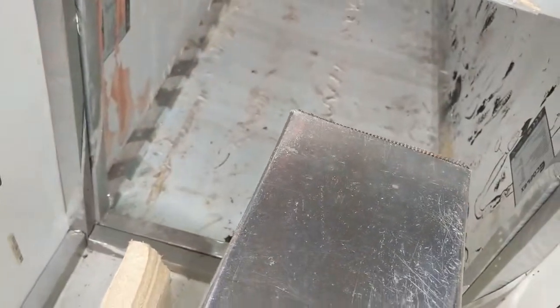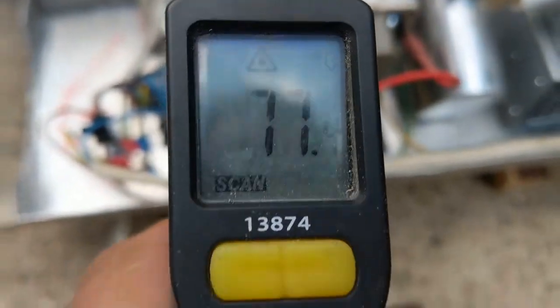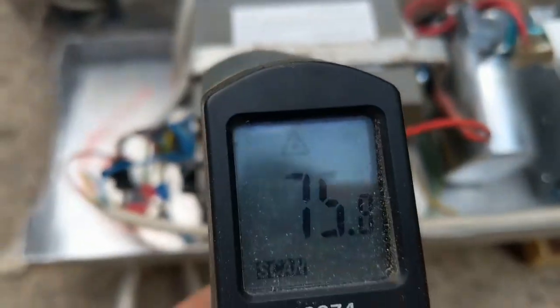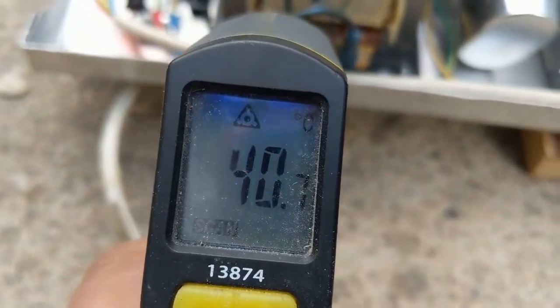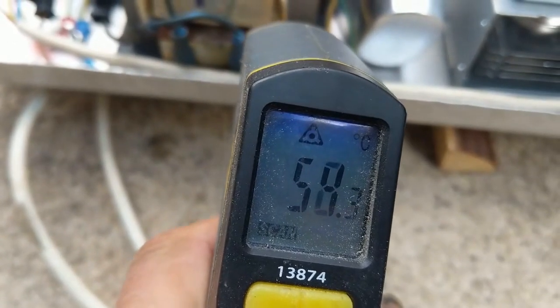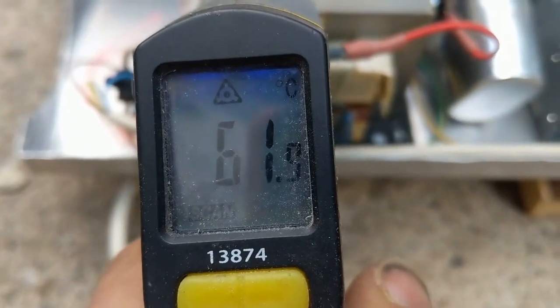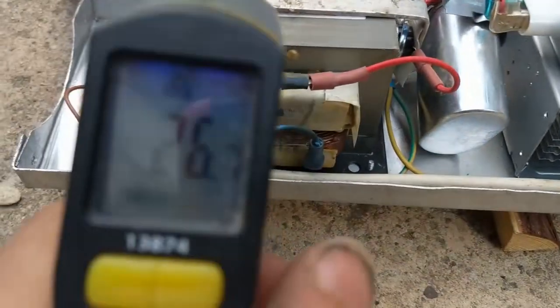Now with the temperature check I can really start adding the other two microwaves so that I reach the final 2.1 kilowatt. Here the transformer — you see 77 degrees, and here it's 100. So 77 is already too much for the transformer I think, so the airflow is not able to cool the transformer. Hmm, don't know what to do about that.